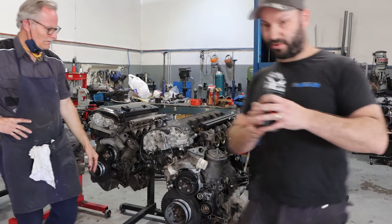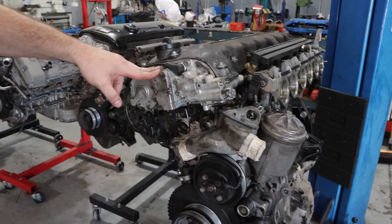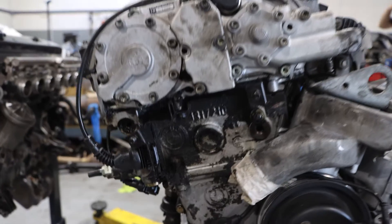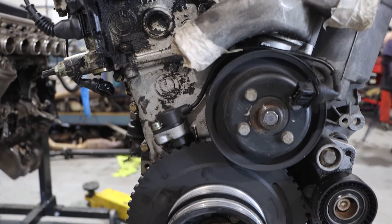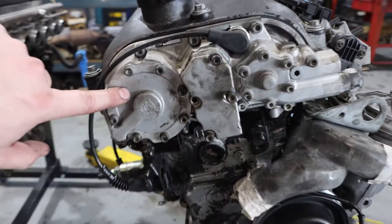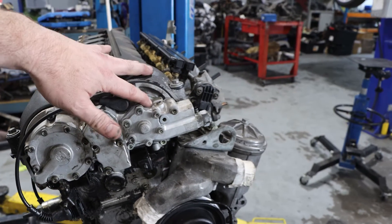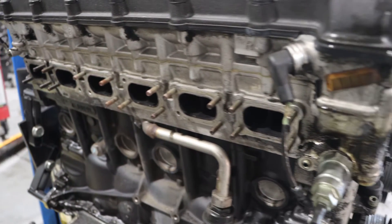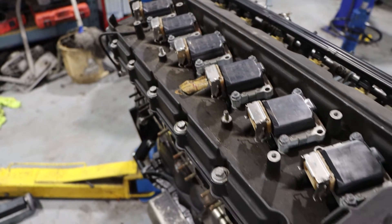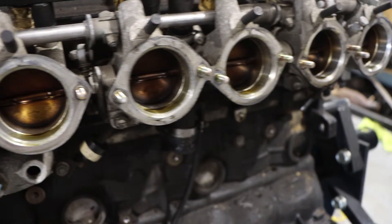Come in guys and have a look at this — we'll go through what they are real quick. A lot of you will probably know what these are just by looking. First one we've got here is from an early '90s E36 M3. This is an S50 B30 — the Euro engine. It's an individual throttle body, six-cylinder, three-litre. It's got variable cam control only on the inlet, so this is a single Vanos engine. This is our high-pressure pump disc that the exhaust cam drives and then feeds pressure for hydraulics to control the variable movement on the inlet cam. It's a cast iron block, alloy head — pretty well the start of the serious six-cylinder engines that BMW produced. That's quite a tired engine; it just needs a full teardown and going over.